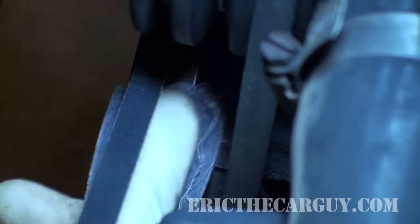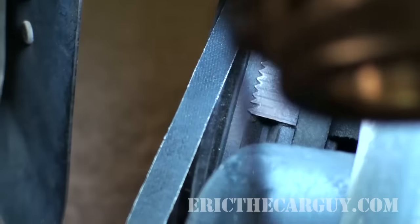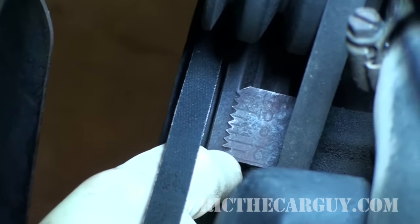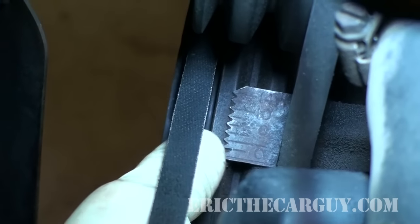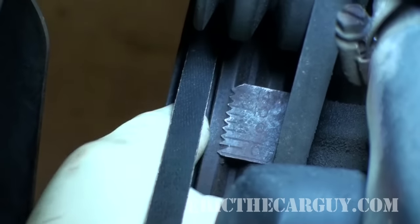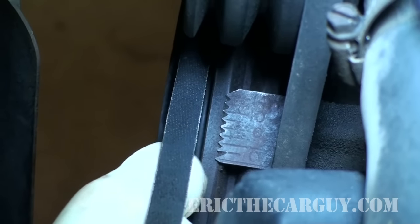Sometimes you can use a little piece of emery cloth to make those numbers a little easier to see. Now if I'm reading this correctly, you can see down here there's our zero mark. Up above it looks like maybe two or four degree increments — it's really difficult to say. But the top one up here looks like 14 degrees. With our test we don't want any more than seven degrees, so if we know this is 14 total, then halfway in the middle would be seven degrees — and that's the magic number we're looking for.